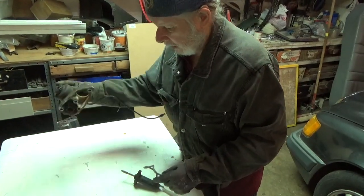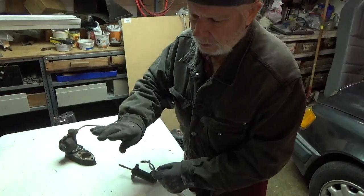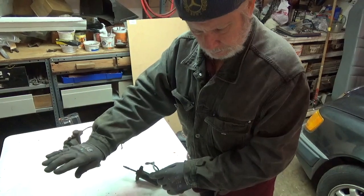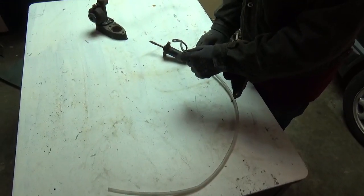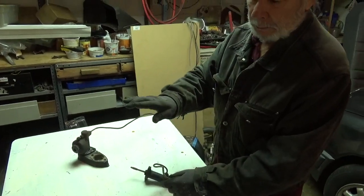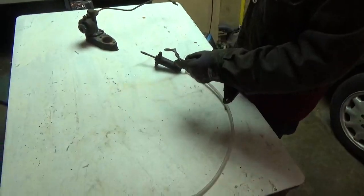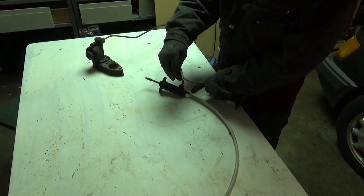not the clutch, instead push the brake pedal down. And when he gets to the bottom, you tell him to tell you bottom, and you tighten both bleed screws. Then have your helper slowly let the brake pedal up and repeat the process. Open your bleeder screws slowly down, and you'll actually see the fluid travel.